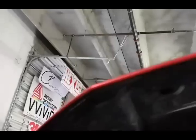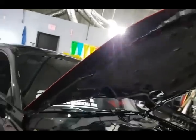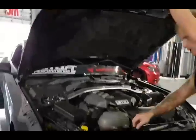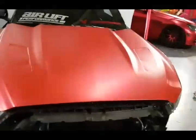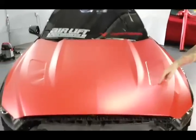You can see I have about three-quarters of an inch or so that I'm cutting off from the very front. It means we probably may not have even had to stretch out the corners a little bit towards the windshield if we'd placed this a little bit better. For me, it's not really worth the risk — I would rather not come up short on the edge of the hood and those corners. I planned for it. On the corners, I like to push down and in so it can come out really nice.